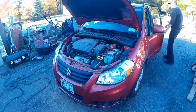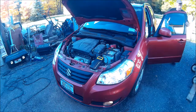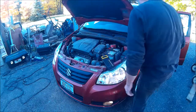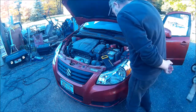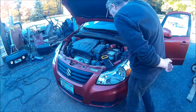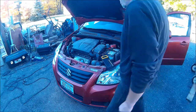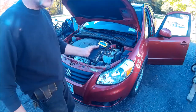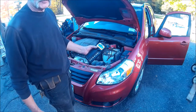We have to turn the headlights on — hopefully I know how — and then turn them off. What this has done is test the cold cranking amps. Now what it is saying is that there is only 321 cold cranking amps in this battery at the present time, instead of 700.